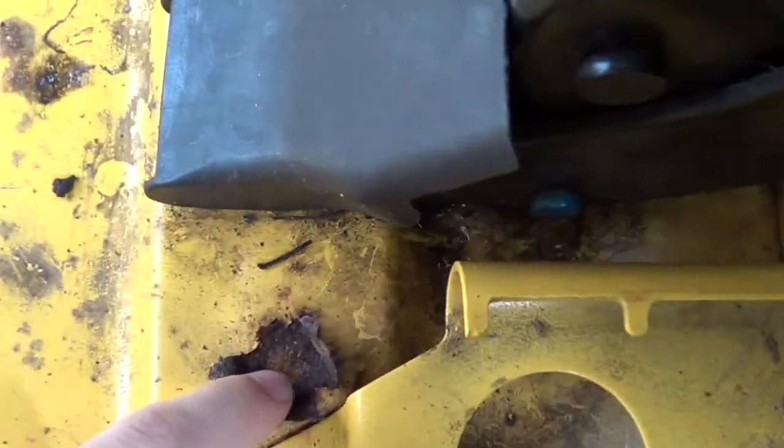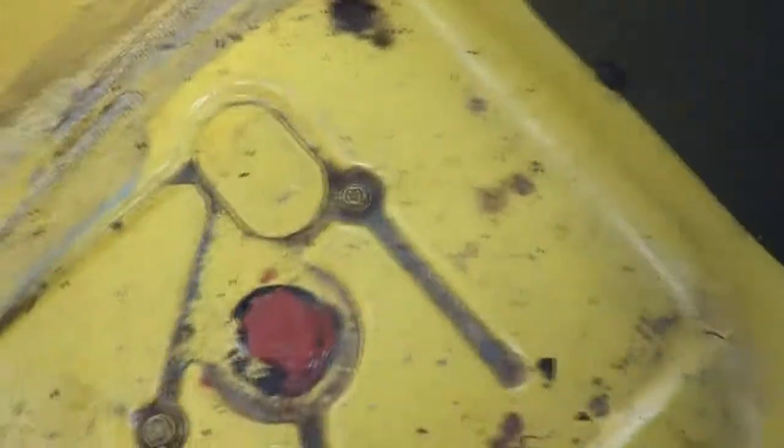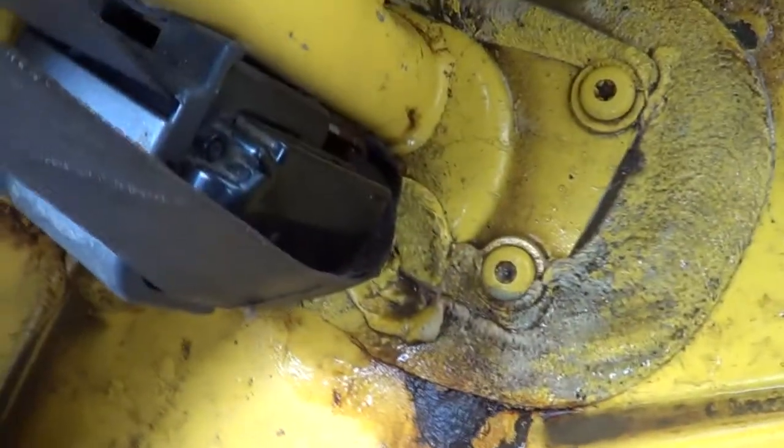I've been cleaning out this stuff. I wanted to get POR-15 going on these. I had a little crack here, had a little crack here, and I just started to lift them up, and I'm going to sand away the edges there. Pretty much the goal for today is to get this all clean. I started out just to clean off these little spots to POR-15, but I started getting here behind where the roll bar meets the floor panel. This side has like the factory weld, and then you follow the factory weld, and then over there on the driver's side the factory weld ends - it doesn't actually go onto where it meets the floor panel there.